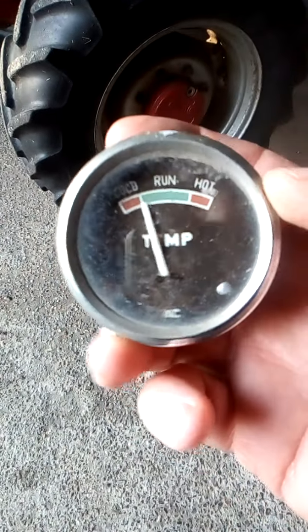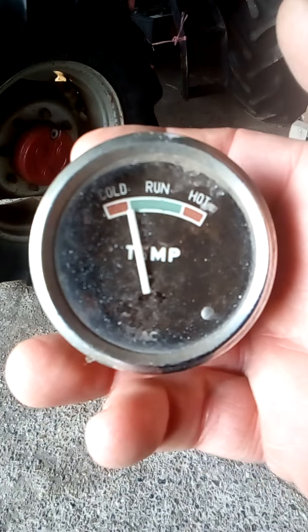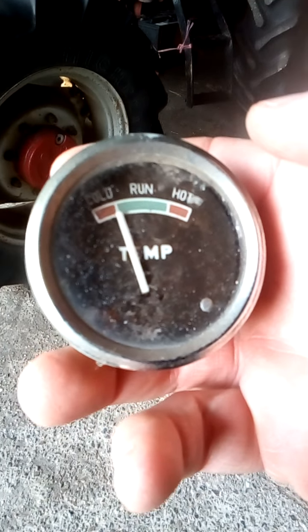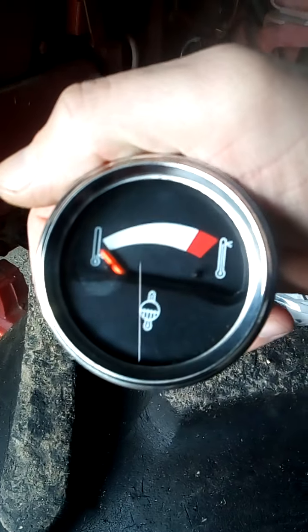So if you want to tell the temperature and you're going to use the electrical system, you need to replace this. But the thing is, there's a calibration issue — they just go bang right up the top. Now the other one has got, like I say, a millimetre from normal operating temperature to getting warmer. So I think it's got just enough to maybe let me know whether it's hitting the white line kind of thing. That one there, absolutely — just before you've even got it up to temperature, just bang, right on the stop. So what to do, I don't know. I'll probably just have to leave it for now and leave what I've got in there, which is the new gauge and the original sensor.